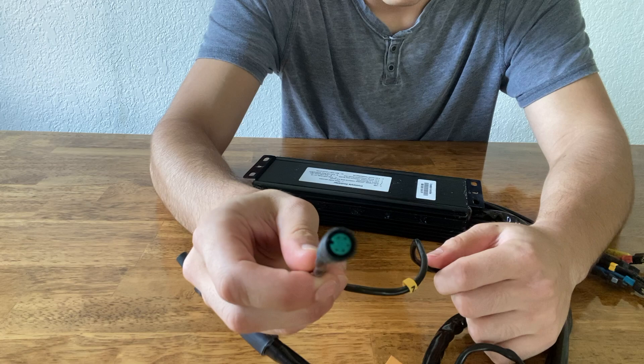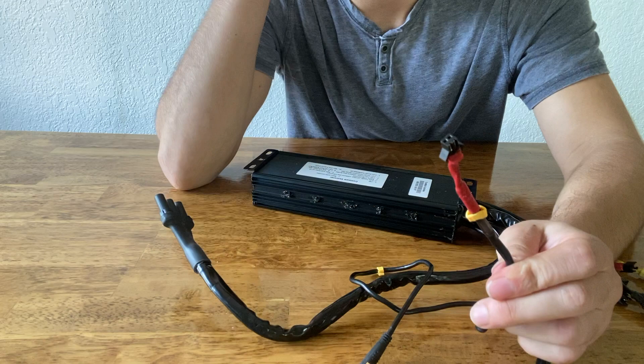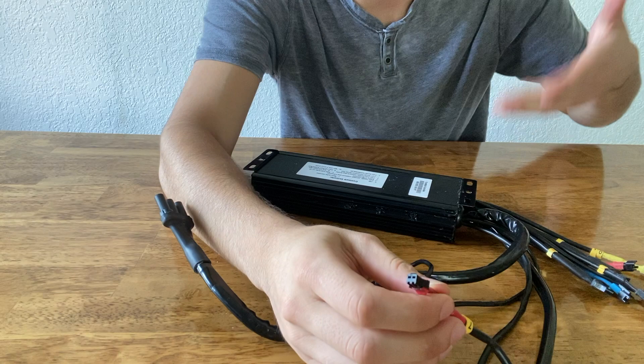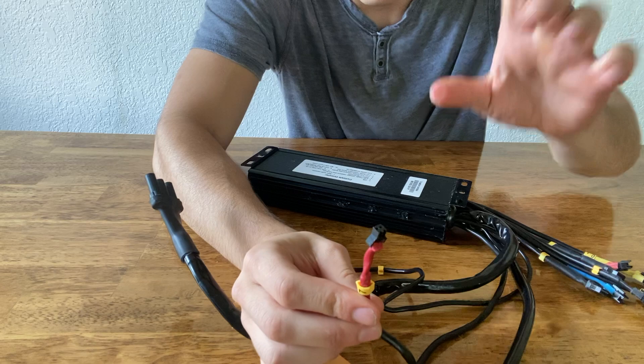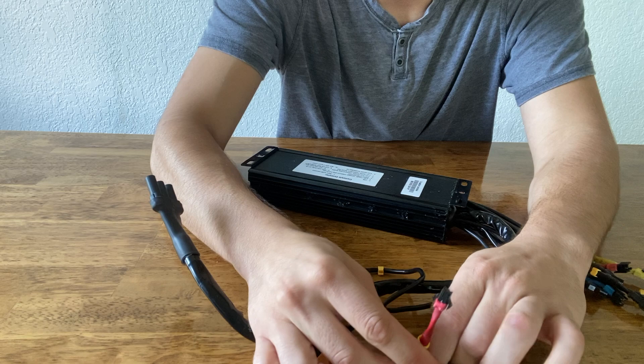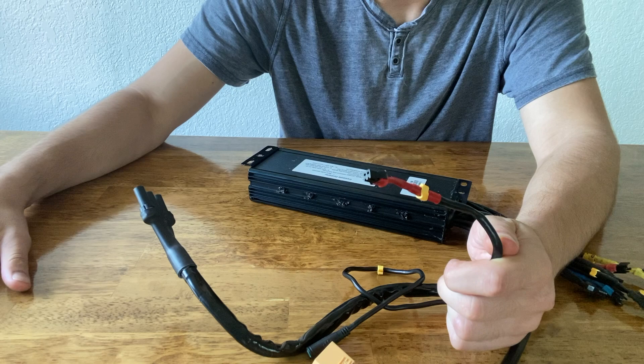The last wire going to the motor is a little two-pin temperature sensor. It's really important to have a temperature sensor so you don't overheat your hub motor, especially if you're trying to push it with a 6,000, 7,000, or 8,000-watt system. If you pair it up with a Cycle Analyst version 3.14, you can see the temperature on your screen display in live time. At 90 degrees Celsius, the sensor will cut the motor back and limit power. At 130 degrees Celsius, it will turn the motor off altogether to prevent overheating and damage.